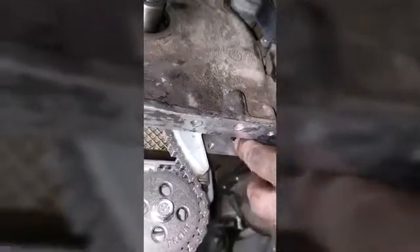After that it'll be tackling the oil pan. Everything's back together up top. Put the tensioner back on, lower pulley, then I'll put the mount on because then I still have easy access. There's the pump in. These lock washers - but there's actually where your old tensioner sits right here, it's actually an oil port. So you're going to want to plug that off with a set screw, just like we had to plug that other one off. If you don't plug those off, you're probably going to have lower oil pressure than is ideal. And you can see those are your mounts, those bolts that are about to go in.